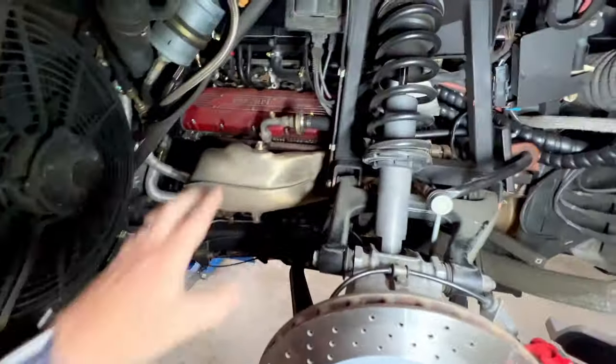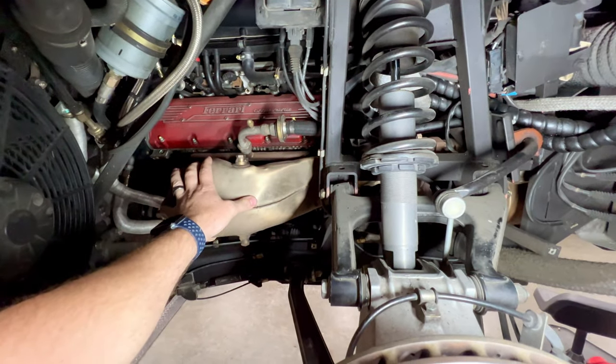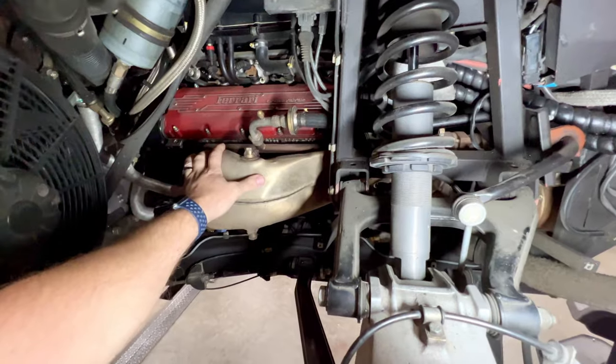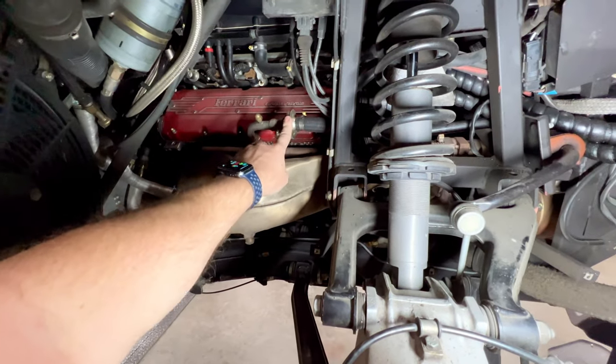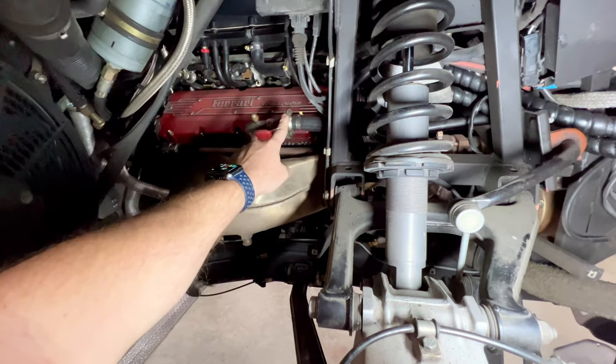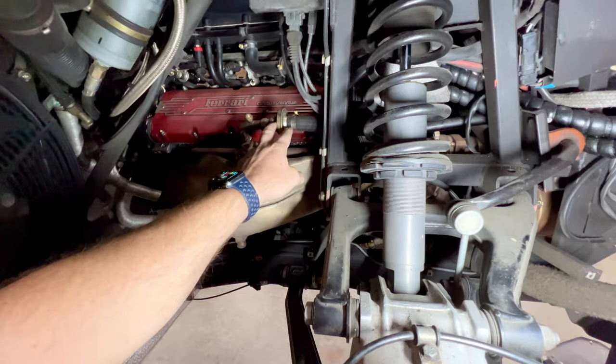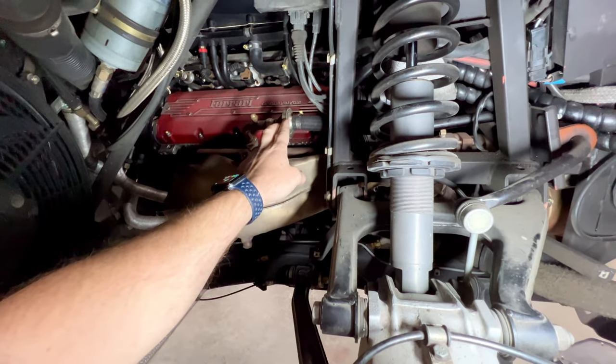One thing I kind of mentioned earlier is exhaust manifolds. We do need to check those. They are very, very prone to cracking on these 355s. So we'll test those a little bit later on. Another thing that you definitely want to keep an eye on is your non-return valves here for your secondary air system. Those fail as well. We'll check those once we have everything apart, and it's essentially a one-way valve, and we want to make sure that it's sealing up in the opposite direction.